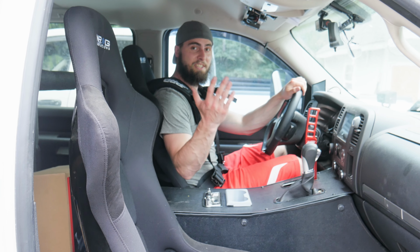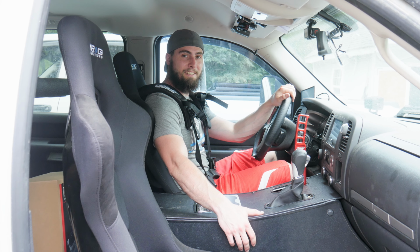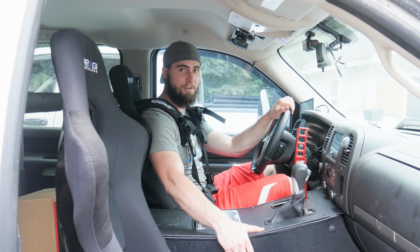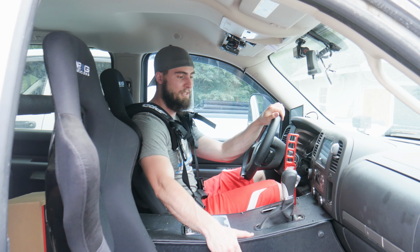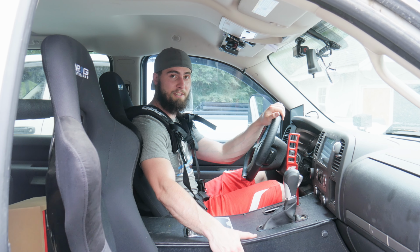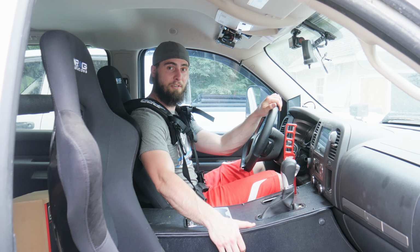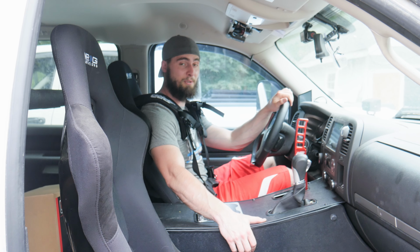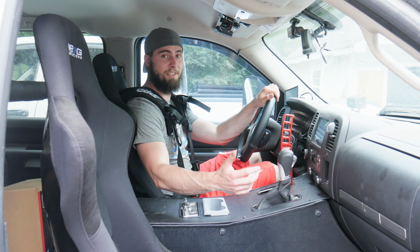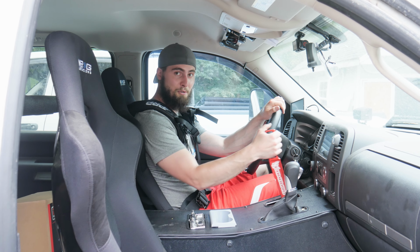So now we just gotta, well, we found out we gotta pull the motor. I got low compression in one of the cylinders, gotta do a compression test to figure out what's going on there. So pulling the motor, gonna cam it, new lifters, new push rods, new springs. Full rebuild, baby. Full rebuild. If we got it out, probably do the torque converter too as well. And then that's pretty much everything driveline wise that we're looking at doing. So, you know, rebuild the engine, torque converter. We already regeared the front, gonna regear the rear, do dual brakes.